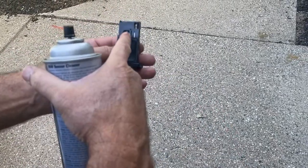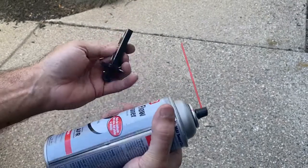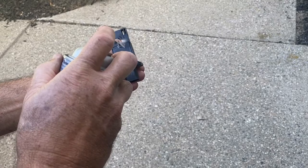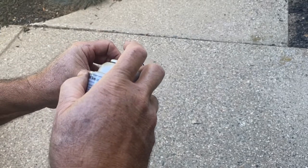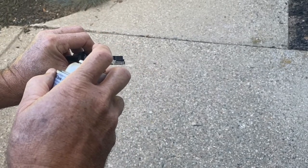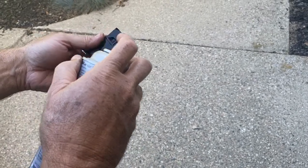What we're going to clean is these little wires down in there. It reads the air that flows to the motor, so it's important that these are clean and working properly. You can see there's some residue right there. Once we clean it like that, we're going to let it set for five minutes and reinstall it.